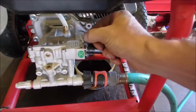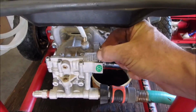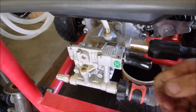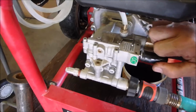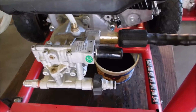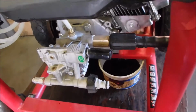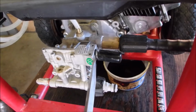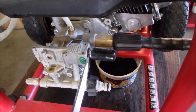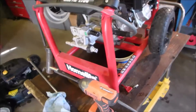Okay, so I've just pulled this out of here. These 2 holes, you see that? There, the retainer. And now I'm extracting just the rubber right now. Oh yeah, I better turn off the water. See, that's what's nice about the quick connects, eh? And now I can just probably pry that. I don't have 3 arms, guys, so I'm just going to bring that out like that. I'm going to use one of the springs and just bring it out. Sorry, I don't have 3 arms, but it'll go.